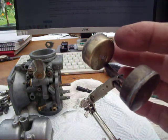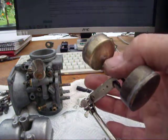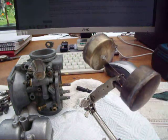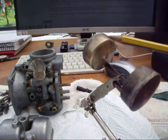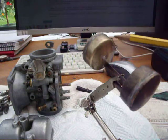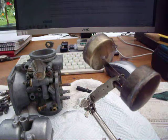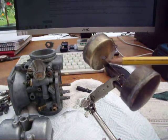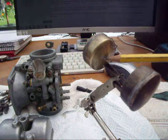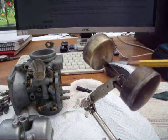One way to get that out safely is to use a soldering iron and just take away the solder where the floats are sealed after they've been soldered. These are soft soldered together to form the cylinder, and that last hole there is sealed — you just need to desolder that with the soldering iron. Once you're sure you've got a little hole there, you should be able to see a little bit of fluid come out if you put your finger on it or a bit of tissue.